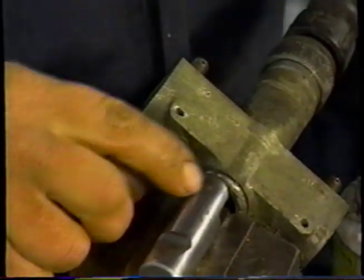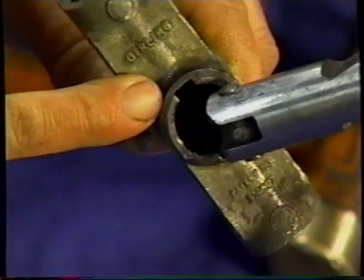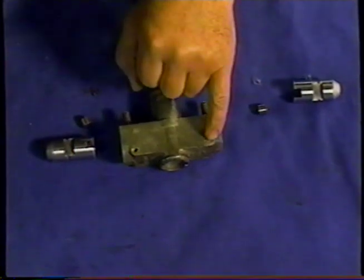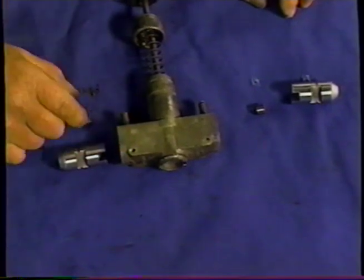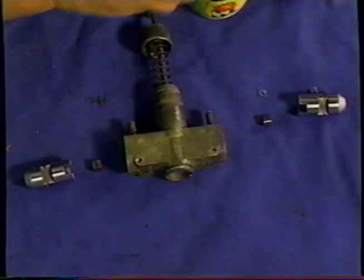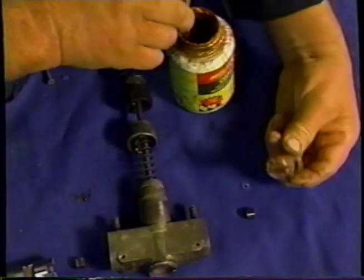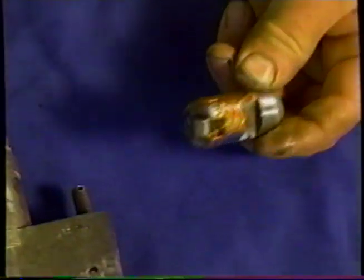We've made that very flush, you can see that. Now I've split the difference. There's two slots there, and we'll slide the expander in there. So we've got the rivets on the same side as the cutouts. Cutout, rivet. Our two rollers. And we're going to put some grease in there, some anti-seize type stuff. Put that up. Put in there. Give it a good coat in there, and that allows us to put the roller in there.